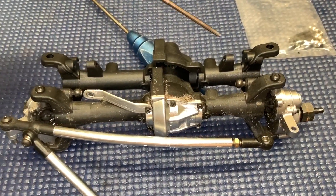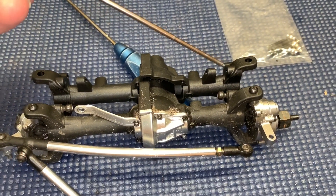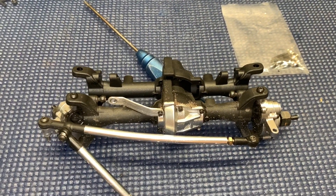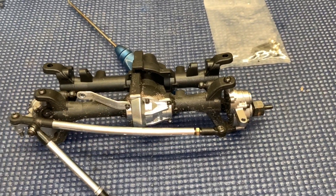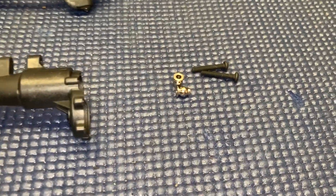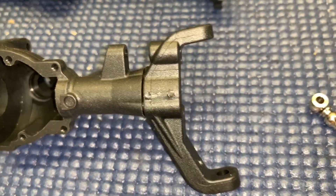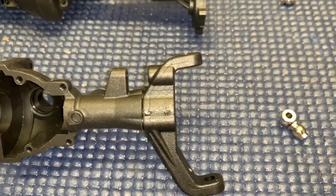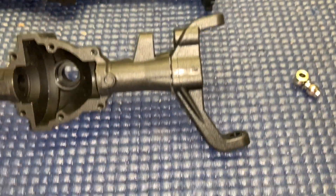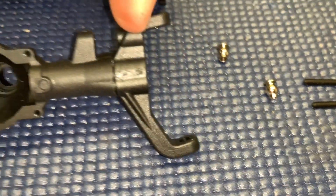With the new axle, you get some double shear for your shock mounts right here and here. You can put them in the back in the stock location if you want, but I'm going to go ahead and use these. This bag right here has some different screws in it. These screws right here actually go through the top once you get the small three screws that actually hold the C-hub in place. So once you take that off, you'll reuse those screws to pull this one in place.